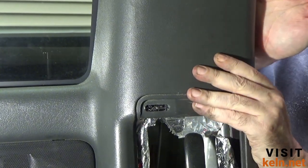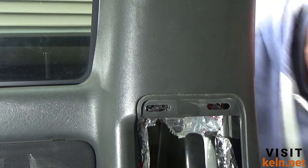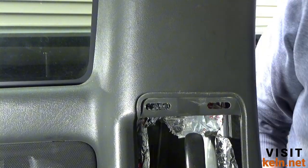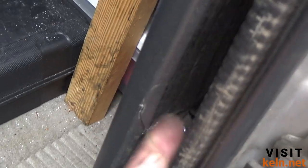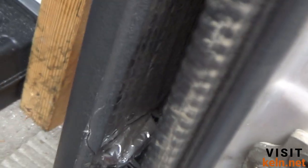I heard that first one pop — that's a good sign. There's another one; should only need one more. I could probably squeeze my hand down there now but it won't be comfortable. I mention this every time we deal with interior plastics: I once tried to pop this when it was like three degrees outside — don't do that. Work on plastics when it's at least 50 degrees so there's more flex.